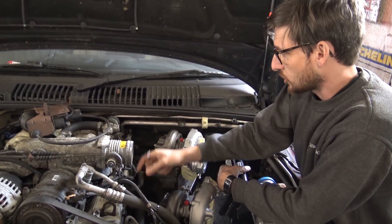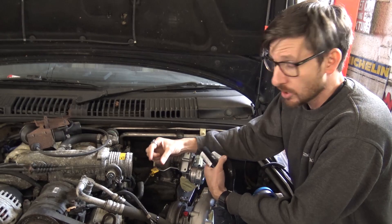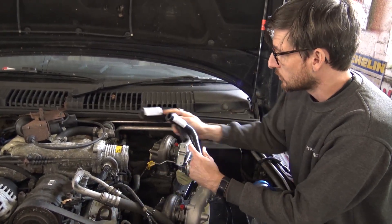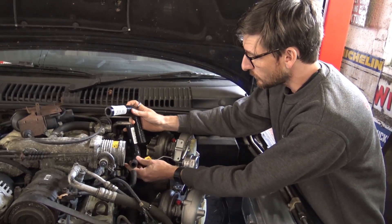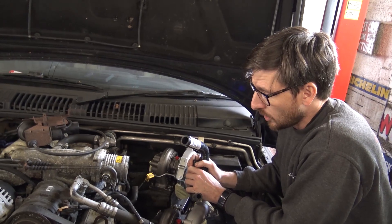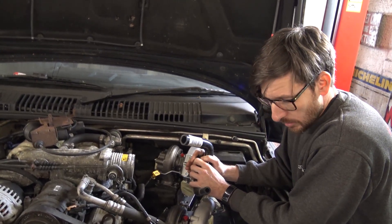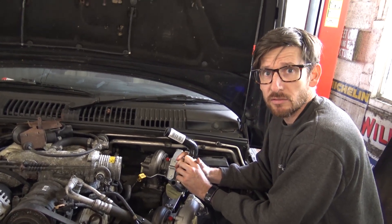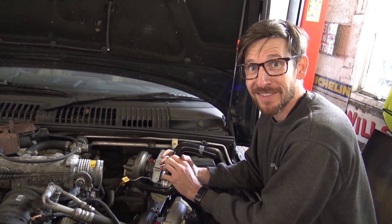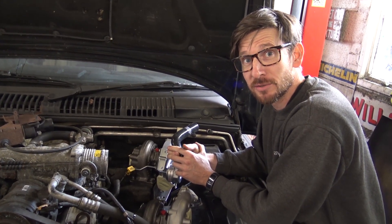Sometimes you've got to just order pipe and see if it's going to do what you need. The original idle valve went into the plenum hose, which I could weld a boss onto the ally. However, the breather setup is totally going to change - you can't run a pressurized system on a conventional breather setup. The ports around the back of the throttle body will be left redundant. I'm going to carry out a test running pipes from the idle valve down to the breather port. If the breather port needs opening up we can machine that out. I think that pretty much concludes the update this Tuesday - although it's Monday.